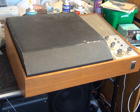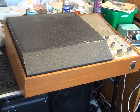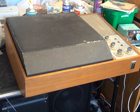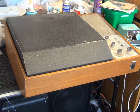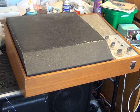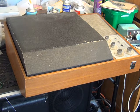Today we have an Ultra record player, model number 6042. It's a mono single-channel record player but fitted with a stereo cartridge switched for mono operation when used standalone like this. With the optional speaker amplifier plugged in, it switches to stereo — this becomes the right-hand channel and the optional amplifier becomes the left-hand channel.